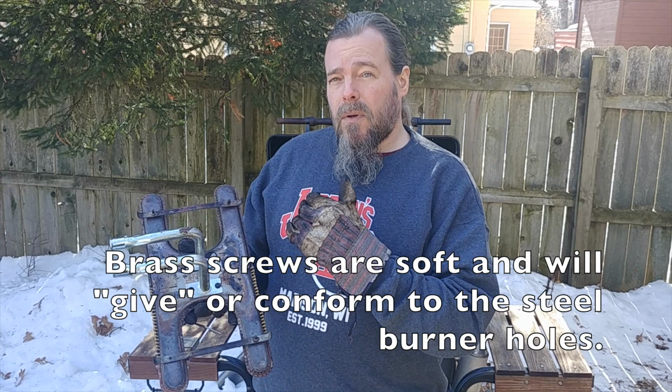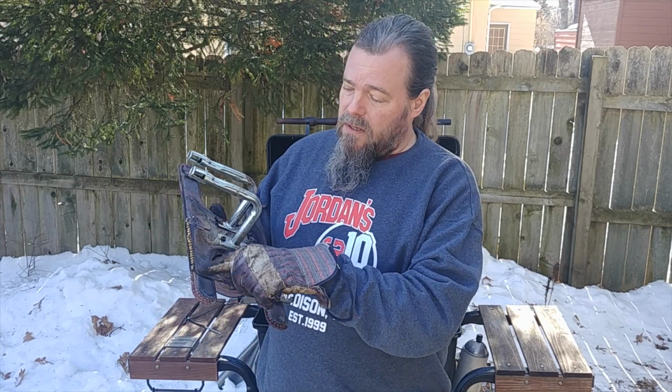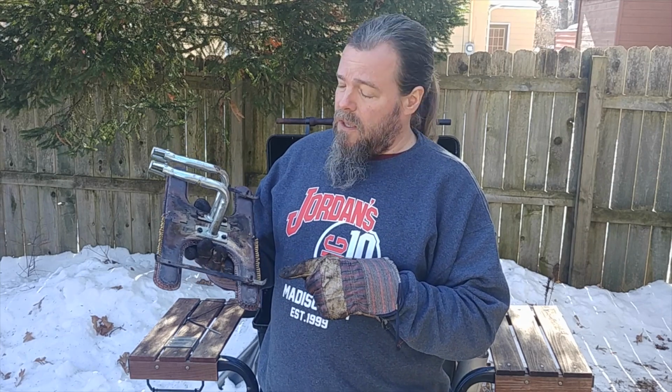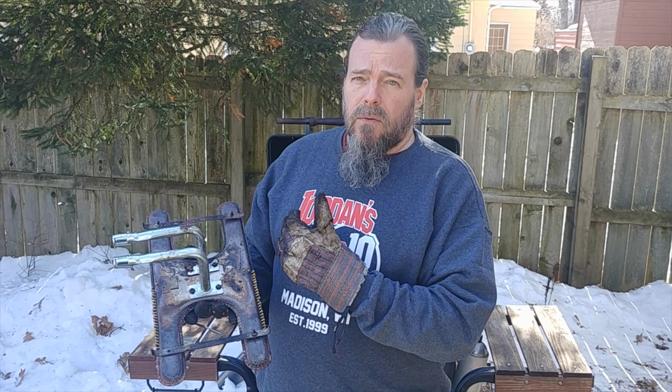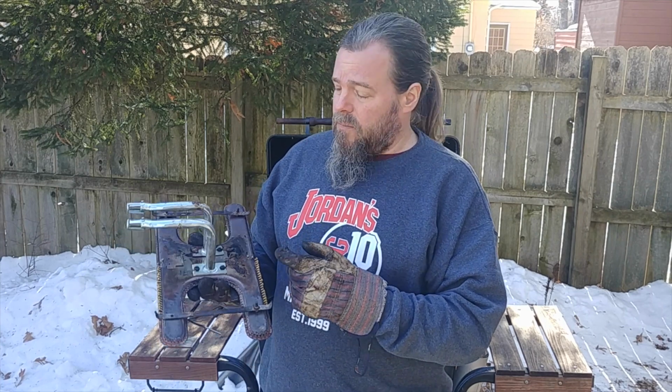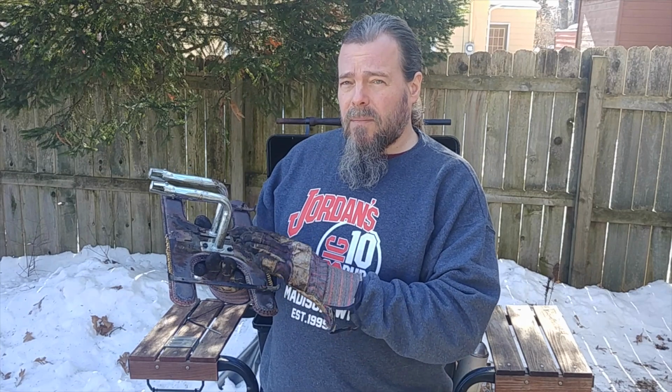low volume orifice in there that there was no way that enough gas was going to be there to light the whole thing. So there's a couple modifications. Not only did I change the orifice to be smaller, so it's the lower BTU burner, but I modified the burner itself because those are kind of matched to the amount of gas.